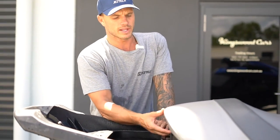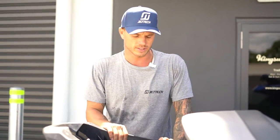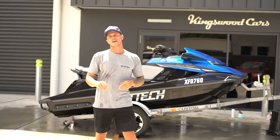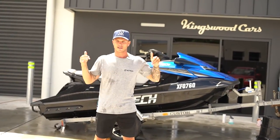Depending on your storage situation: if it's in your own garage and not a communal basement, leave the seats off. It's always good to store the ski with the seats off and left in the upright position. If you can't do that, find something to jam underneath the seat so it can breathe — your engine will still be warm, and heat plus moisture is just asking for corrosion. That's a step-by-step guide on how to clean and maintain your jet ski using the Salt Shift products. If you've got any suggestions or questions, drop a comment below. Happy days till next time!